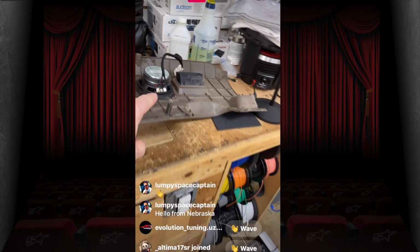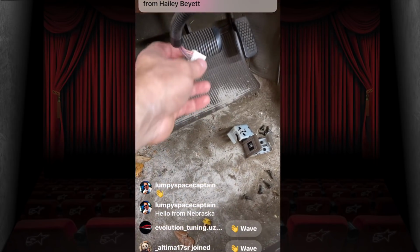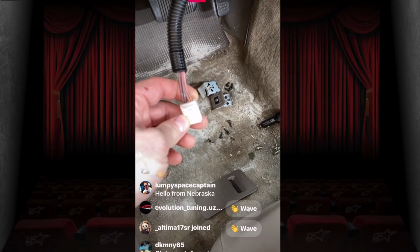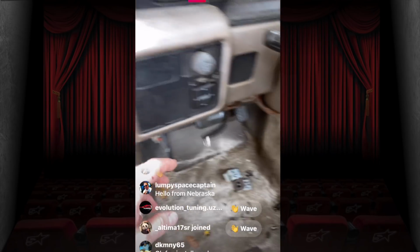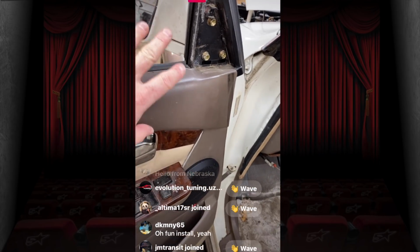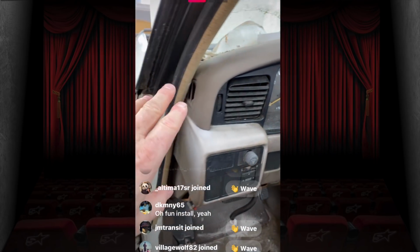And the unique thing about this, and this is the case in a lot of Toyotas, if you'll notice, see how you have 4 wires here? The tweeter is the pass-through. So it's like this on pretty much all the Toyotas now. So if you have the tweeter or the mid-range up in this area here, the one up here in the dash, that's the pass-through.